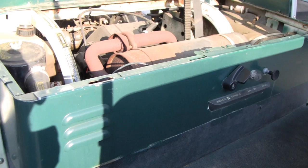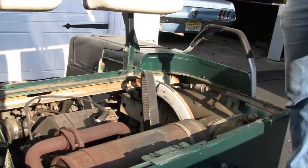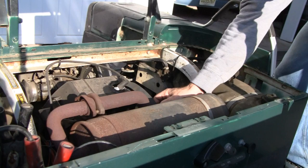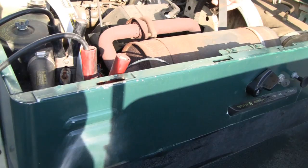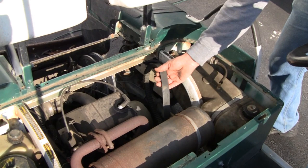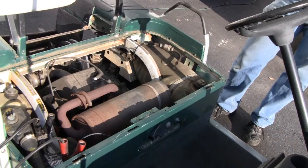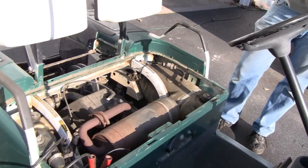I got some ether here. Alright Bob, give it a go. We'll hook the battery charger up to it. Try to start Bob. Let me spray it — get a little ether here. There we go. I'll keep it running with ether. If I stop with the ether it wants to die. It wants to die without the ether, so it must have a clogged carburetor. I'm going to leave that to you Bob — unclog that and you'll probably be alright. Nice little machine you got here for nothing though.